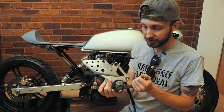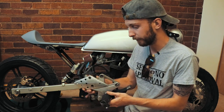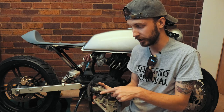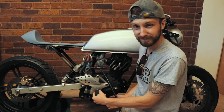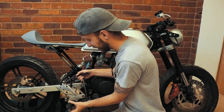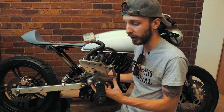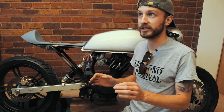I tried to think of a few different ways we could go. I bought this — it's off a CBR125, which is what the swing arm came from, and I thought it might have a chance of fitting. It comes with the master cylinder, the brake switch, the reservoir, everything including the pedal. I had a look and I thought it might fit somewhere, but looking at it it looks stupid and there's no way for it to actually bolt or mount to. I could have put it down here but that would have needed a lot of fabrication work. So I threw this idea out the window and thought the most straightforward — yes, it's the most expensive way — is just to go with this thumb brake.